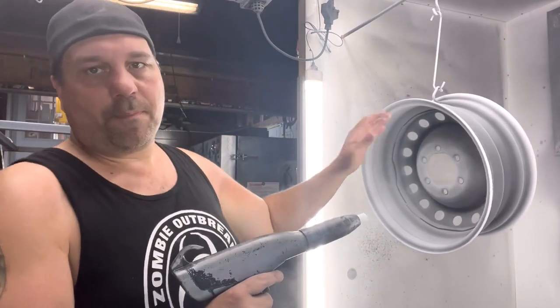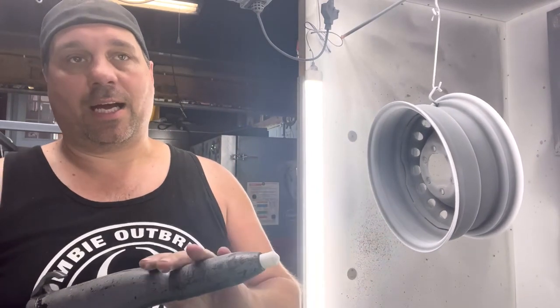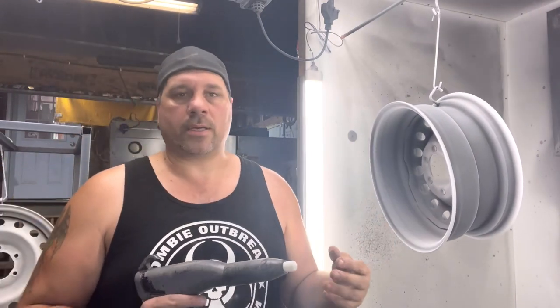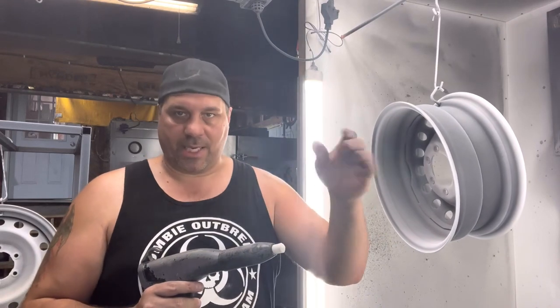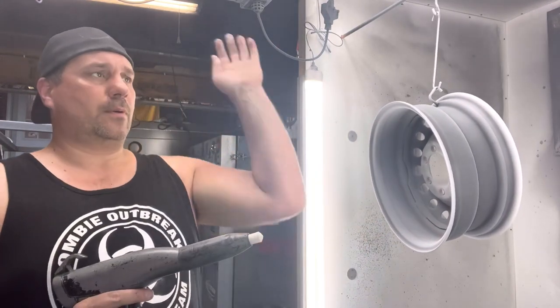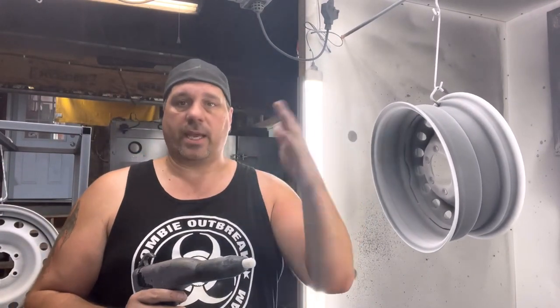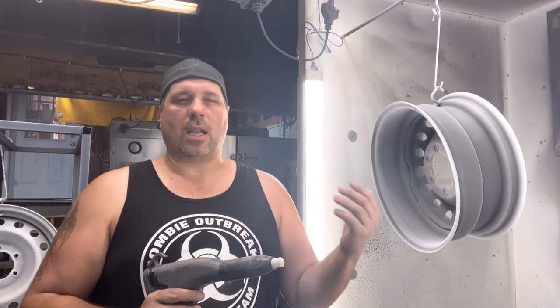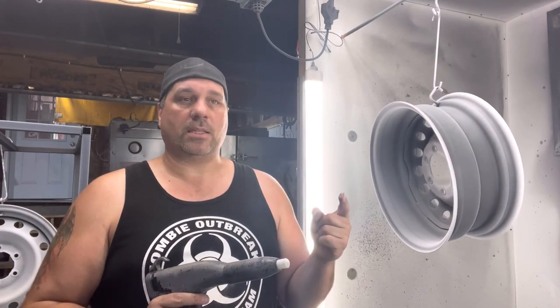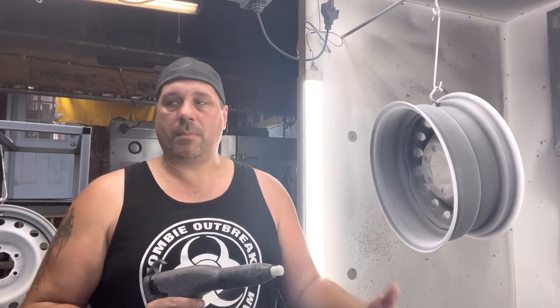Start with the top back. I just did this backwards because I was talking and I wasn't thinking. Clear coat, color coat and clear coat, you always do the back first, then the front because of the framing. So if you go backwards like I am, you're gonna have to go over the front again to get the framing out. A lot of my videos I explain framing. Maybe I'll do a what is framing video. Yeah, that might be the next what is.